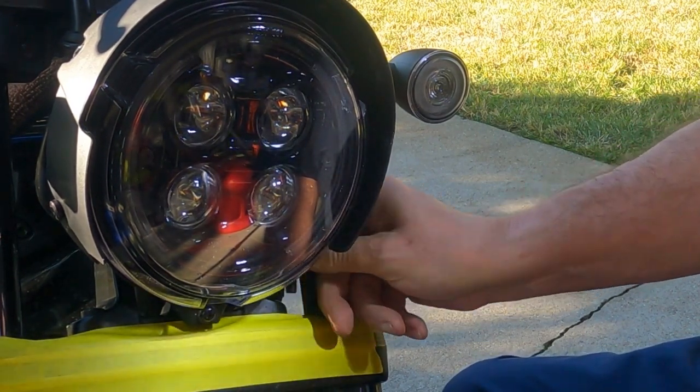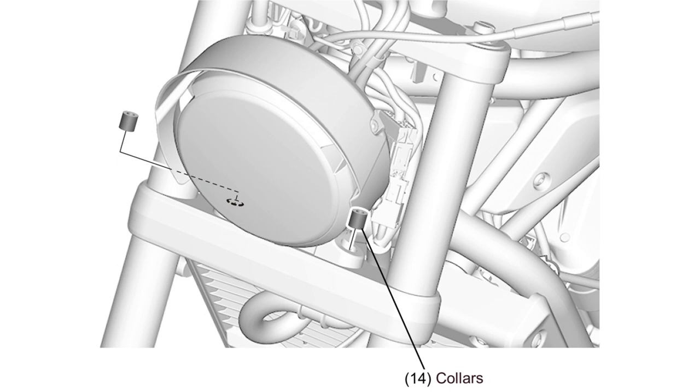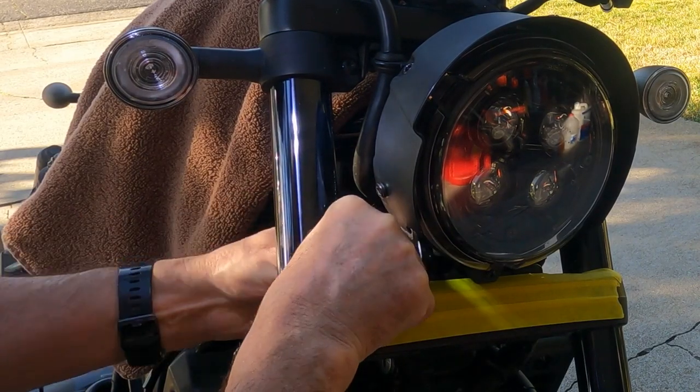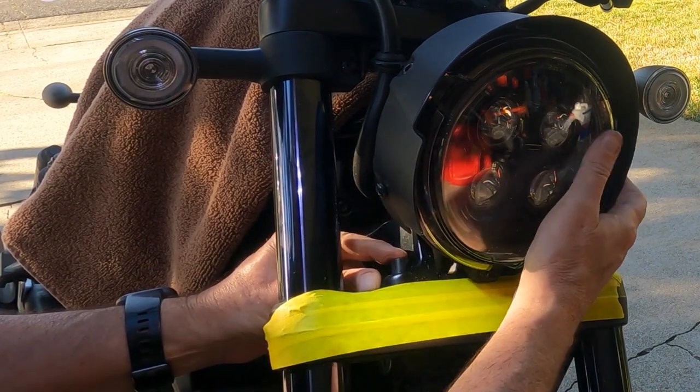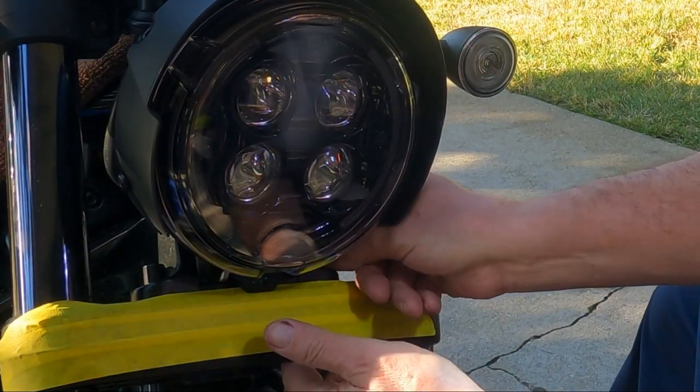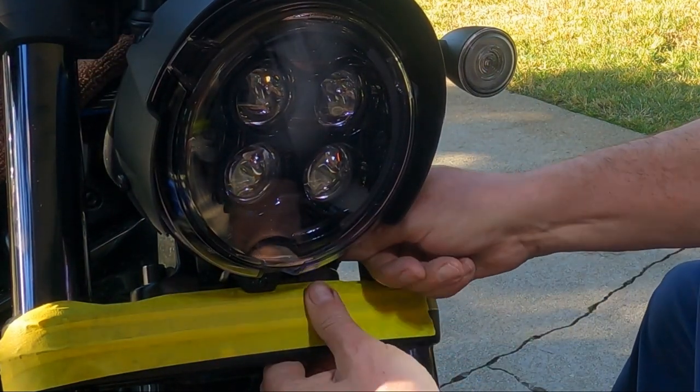After you have removed the two hex bolts, insert the two metal collars into the recessed holes where the bolts were. Be careful not to drop the collars. The collars will eventually be held in place when you reinstall the replacement hex bolts. You might want to secure the collars temporarily with masking tape.